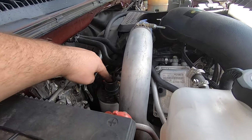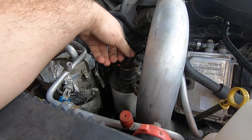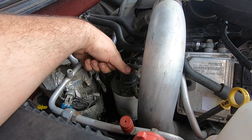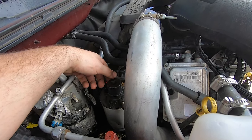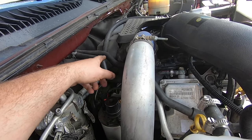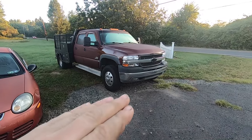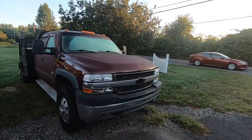One thing — this bleeder was super mushy before, you'd push it and it felt like a piece of junk. Now that this is all primed up, this thing is rock solid. You can move it a tiny bit if you want to, but you really can't move it much — that's a good indication we're holding prime. I'm going to let the truck sit for a couple hours, make sure this is still hard, then give it a cold start, record it on HP Tuners, and see how quick it builds fuel pressure. It's the morning — 12 hours later. Truck sitting with the front end higher than the back, which is worst case scenario. Let's give this thing a crank and see how she does.